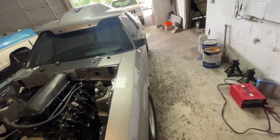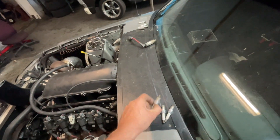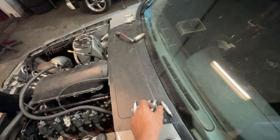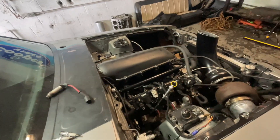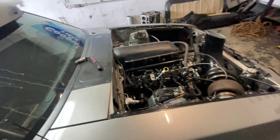Then come over to this side over here — this one looks good, looks good. Missing something. Third one back on this side. I'm going to do a compression check to see what's going on. I knew in that burnout in that last video, I didn't feel it inside the car, didn't hear it on the burnout or nothing. But inside the car it didn't feel right. Outside when I'd done the video last night, it didn't sound right. I felt something towards the end of the run. So we got two of them bad.